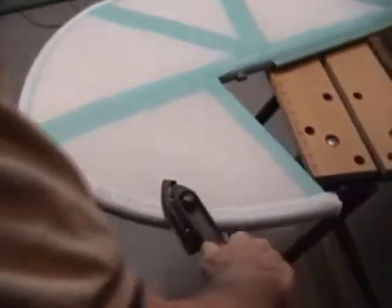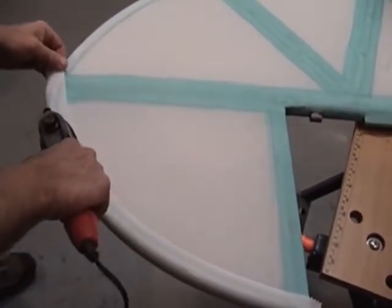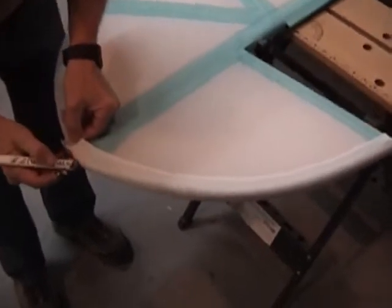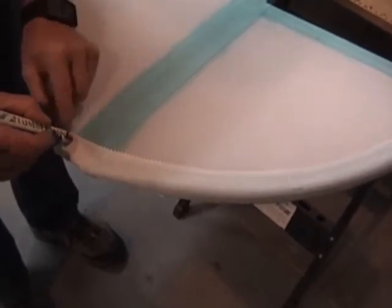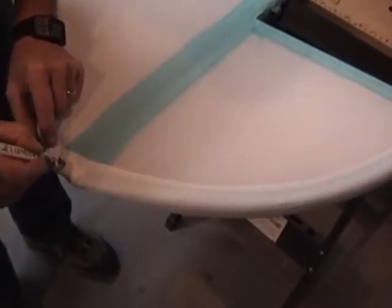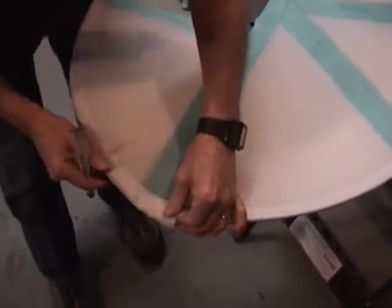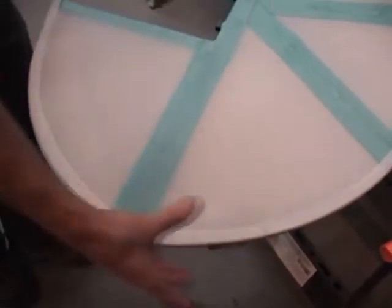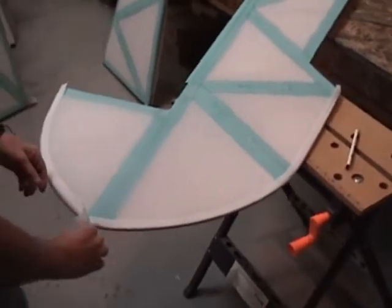I actually prefer coming from this direction — I can kind of see what's going on with the tape a little more. You can see where our leg comes around here, so we can start about right here and just kind of run a pink. We want this to be able to blend, so we'll just pink this edge off around here like this. You can get as artistic with this as you want. Notice this is the direction the airstream is flowing. We like to let this tape finish with the airflow, so that's one reason we laid the small tape first.